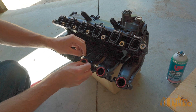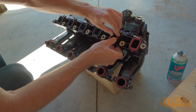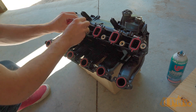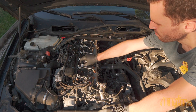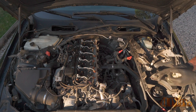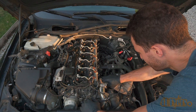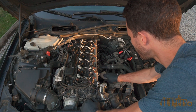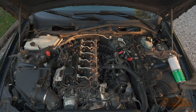With every sale from the links I do get a bit of a kickback to help keep my channel going. The old intake gaskets are removed with a standard screwdriver. This intake was soaked in a homemade hot bath setup to remove carbon buildup — a common issue on these engines. Those grooves are cleaned for the intake gaskets and new gaskets are installed. Paper towel was removed from each of the intake runners. The sealing surfaces for the intake gaskets are also cleaned on the engine side — Scotch-Brite can be used on the head; for the valve cover just use a light degreaser and a rag.